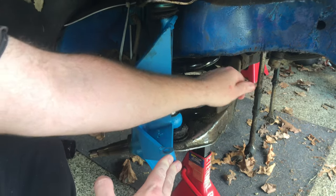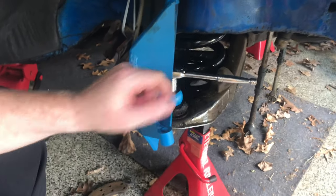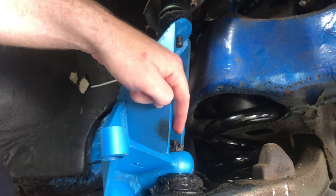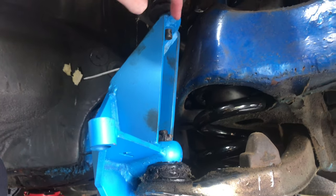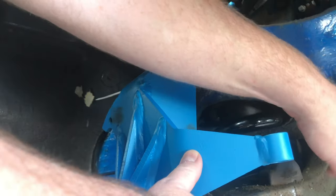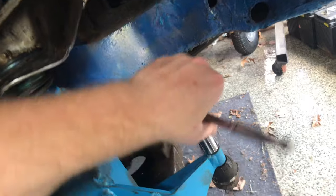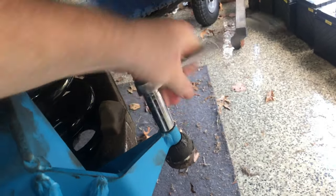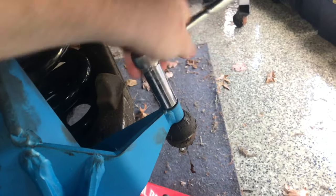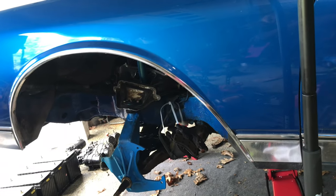So we're just tightening up the lower ball joint castle nut — I just need to line it up for the pin. The cotter pin has been installed in the lower ball joint. I've got to put the castle nut and cotter pin up on the upper ball joint, and then I can rotate this into position and reconnect the steering shaft and the tie rod ends. Upper ball joint is back together. I'm just putting the steering end link back on and tightening that down. And this would be the all-the-way locked-up height of the setup.